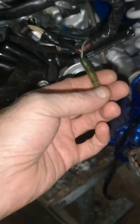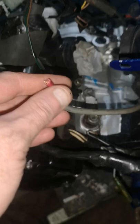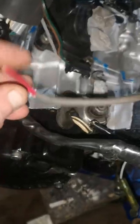And I've got that old case. It's just an old one. So that's the stator in. Tightened up. That's the stator on now. Carb's not on. Anyway, this is on, rigged up. That is unrigged up down to the neutral switch. Starter was off a Gilera and had a square terminal there, so I've had to cut that off. I'll put a ring terminal on later. This is gonna try for spark.